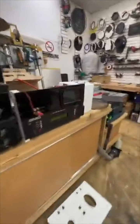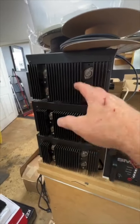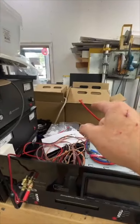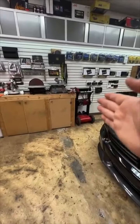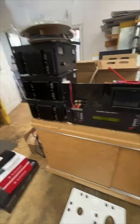All right, let's take this from the beginning. Let's talk about an amp dyno for a minute, because of the reason why we have the amp dyno. These are 3 Astron power supplies. Each one of these is 70 amps of current, this one is 50 amps of current. They all put it out at 14.4 volts. And these are giant 2150 Stinger batteries back here, the backup. If we need to, we can take that guy and get a 300 amp push at just the right second to try to keep this at 14.4. It's a big pain in the butt.